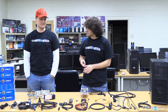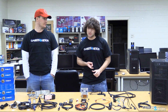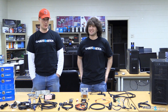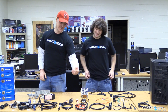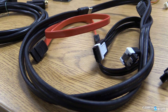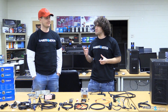Moving into SATA: there are two primary types of SATA cables advertised on the market — 6 gigabits per second, or SATA 3, and 3 gigabits per second, or SATA 2. If you search whether there's a difference between a SATA 3 cable versus a SATA 2 cable, the answer, if you dig far enough, is nope. One thing you could notice is that the SATA 3 standard does specify a little clip on top of the connector. In summary, don't pay extra for a 6 gigabits per second connector unless you really want the clip.